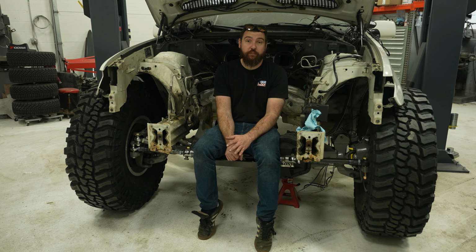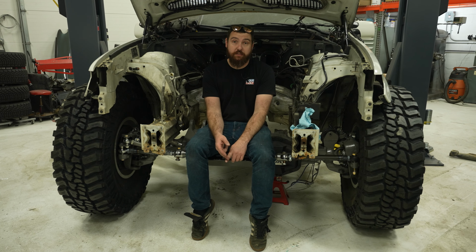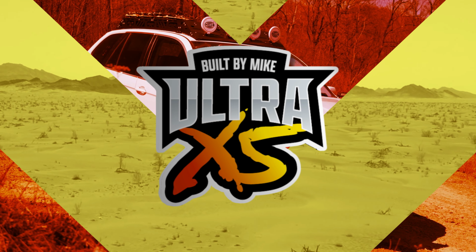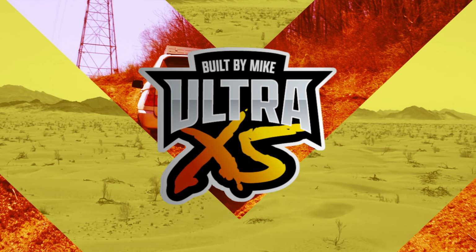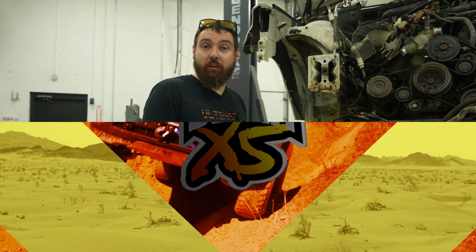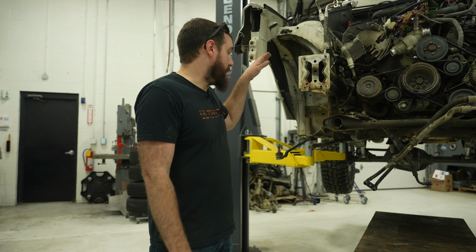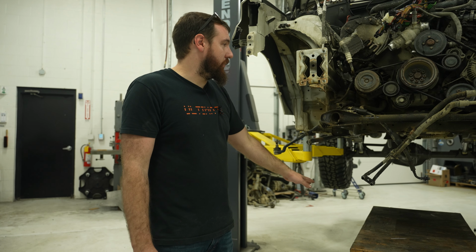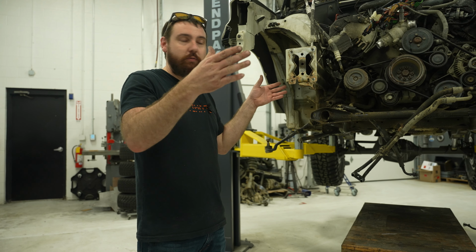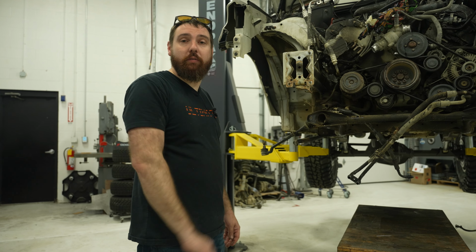This week, we're gonna start on the front. And the first thing we have to do is mount up that Texas Speed LS and that Monster 6L80. So I've unhooked, I believe, everything. We're gonna be sure in a minute. And we're gonna drop the motor out. I'm gonna drop it down onto the cart, undo the last couple subframe bolts and transfer case, transmission mount bolts. And then hopefully pick it back up without dragging the motor with it.